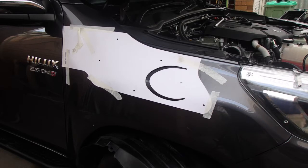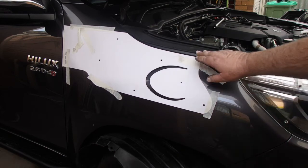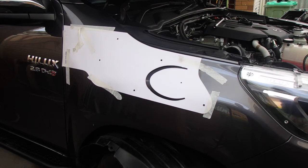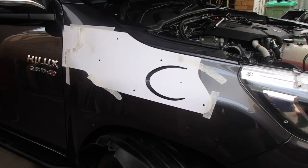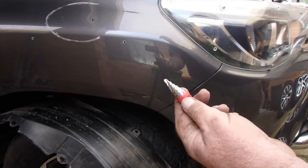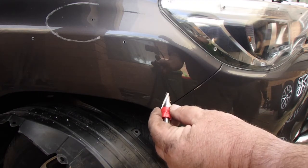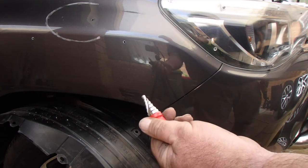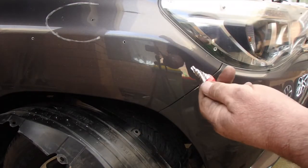Okay, I've got the template on. I found it a little bit difficult to place because the guard has such a bulge on it, but I've aligned it with the edge of the panel. There should be enough wiggle room by the time these holes get drilled. Now I've got to drill these holes out to 16mm using a step drill. I've taped off the 18mm mark so I don't go too far. These step drills are quite good for thin sheet metal — unlike a regular drill bit that'll want to grab and rip through.